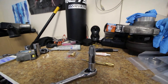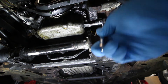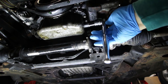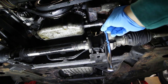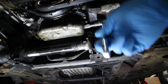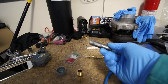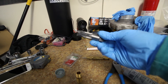We'll probably end up with two or three threads in the hole. I'll do a whole turn clockwise, then a half turn counterclockwise, and repeat. At this point I'm going to check to see how many threads we have and make sure we haven't gone too deep. Our threads are starting to form — just a few more turns and then we'll thread in our fitting. It's also a good idea to clean your tap in between, since the grease catches a ton of debris.